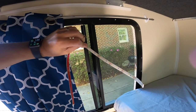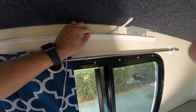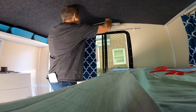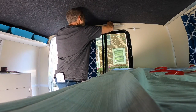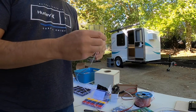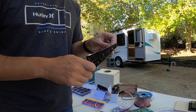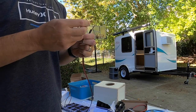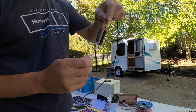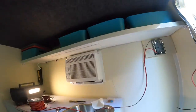Alright guys, I'm going to put this white LED light up on the quarter inch trim that I put here the other day. This way the light will be shining up and I don't have to look directly at the bulbs, but I still get the benefit of the light. I have these white LED strip lights and I'm going through and connecting them. I'll strip off the very end, put the heat shrink on here, and then use these crimp connectors. Then we'll shrink that down and set up all of the wiring to come right here — the lighting, the fan, and the refrigerator.